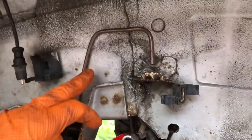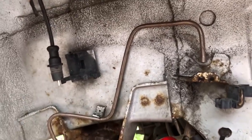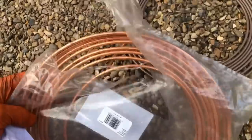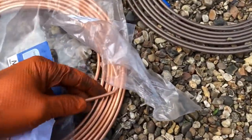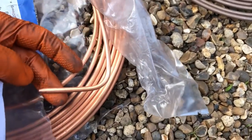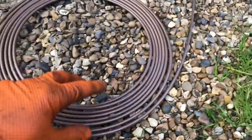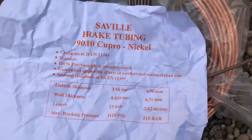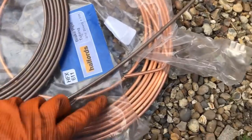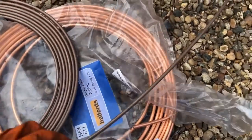The material we're using is not copper. This is the difference between the two lines — this is cunifer and this is copper. Copper stuff is useless, it's really soft. It's good for a quick repair but this is the proper stuff to use. It's non-corroding as well — it won't corrode like a normal steel one from the factory. Copper won't corrode either but it turns green after a while, gets an oxidisation on it. This won't do any of that. You can even paint it if you want — it's even better than the stock lines.